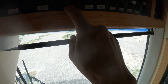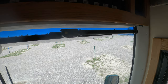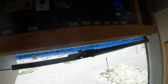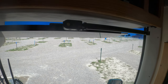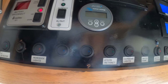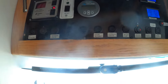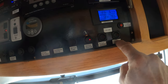Those are spares — if they're not marked, they're just spares. Steps retract — remember, that brings the steps in and out with the door. If you're parked in a spot like this with the steps out, turn that off and just keep them out. But as soon as you start the coach, it will bring the steps in. Curbside lights are the highlights on the curbside. Water pump — that's another switch for the water pump. And then water heater — you've got two switches. Block heater and the water heater here are 110 circuits out here in the bays.